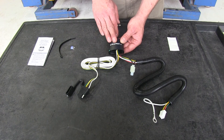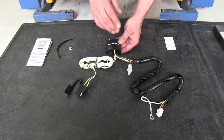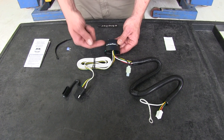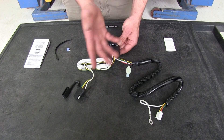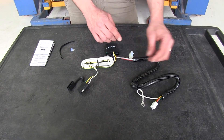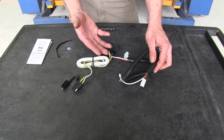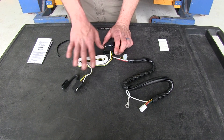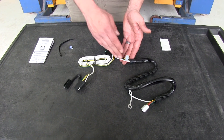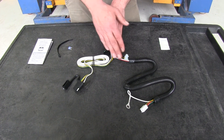The box itself is designed not only to convert those signals into a usable signal, but also to isolate the trailer from the vehicle. So if you have any shorts or anything like that, it's not going to be passed through into the vehicle and cause any problems. You also see the black wire here with the fuse holder — this is designed to get its power from the vehicle, not from the lighting circuits. So any power being sent out to our trailer isn't draining on the vehicle's lighting; it's coming from the powered box itself, so we won't have to worry about any overload situations.